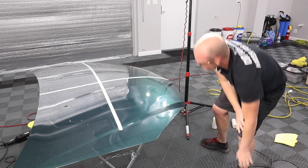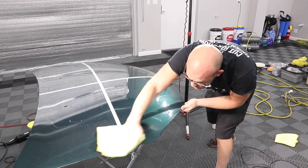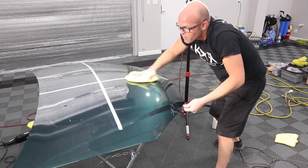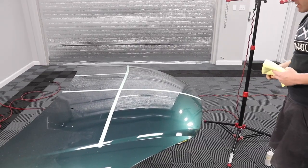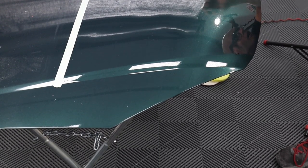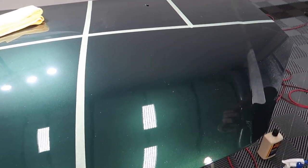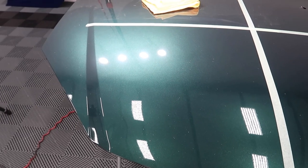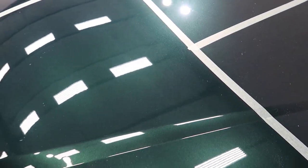The idea of using that 7-inch pad on a 6-inch backing plate, it gives a little easier use in my thought process. And some of the things that we're even talking about, they're unconventional. We get it. But if you try it and it works, you can't really argue that. So besides a couple of scratches that need to be spot sanded right there, and then one there, pretty good. If it looks a little deeper, it's the darkening agent in that polish, in the perfect finish, probably? Correct, something actually in the product to create this darkening effect.